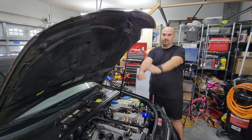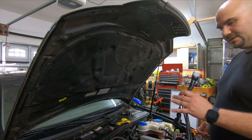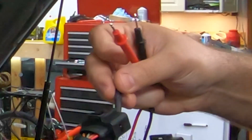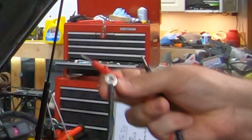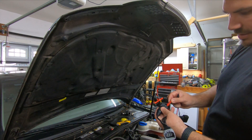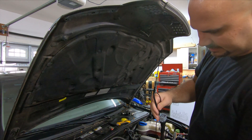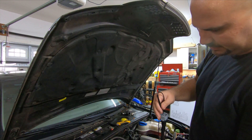The new title of this video is 'How to Rewire Your Ignition Harness' — this is all my fault. We're currently testing the pins to figure out which way everything is going. These are numbered one, two, three, four. Pin four is the ground, and they're split — two pins to one side and two to the other. I'm going to put this into pin one on the furthest back cylinder and test it.